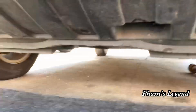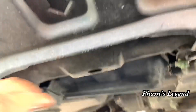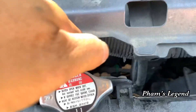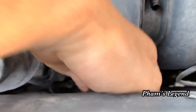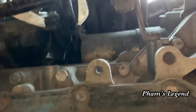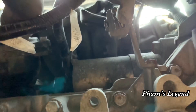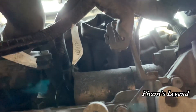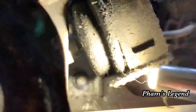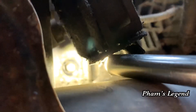I have the car underneath and I take out this panel right here, because the bolt on the hood latch bar goes straight down there. The bolt in there is a 10 millimeter on the frame, so we have to take that out to move this up. You can see the starter from the bottom view — you can see that starter right there. Obviously you cannot take the starter out from the bottom, it has to come out from the top. You can see that 10 millimeter bolt right there.